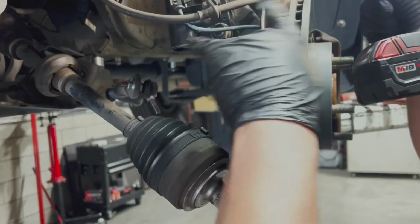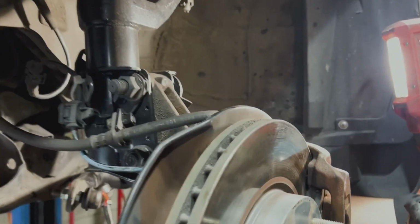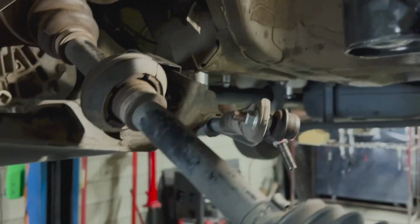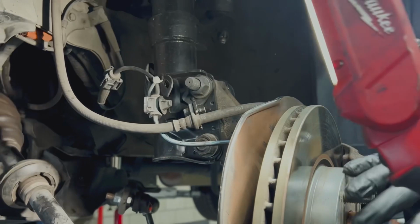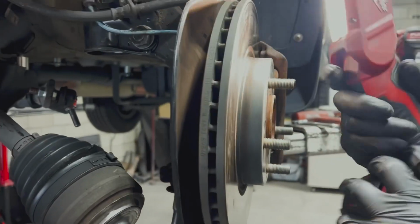When installing the new control arm, we can go about this a couple of ways. We can lower the subframe, loosening it up to bring it down about 1/2 inch, or we can take off the entire spindle. This will allow you to inspect everything, since everything's disconnected.